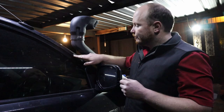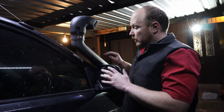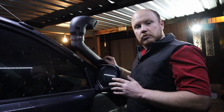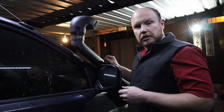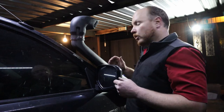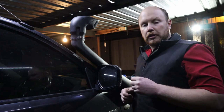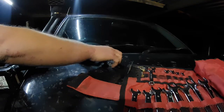I do know that when they're fitted, they're supposed to be supplied with some little rubber or plastic grommets that screw in and spread open, but they do pull out. I didn't fit them when I originally fitted the snorkel — I just fitted the screws — but now I'm fitting these rivnuts. So let's hope that once we put it all back together, it's as strong as we're expecting and will do the job. Let's go and grab the bracket and get it back on.